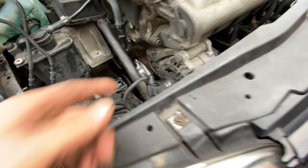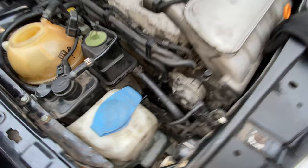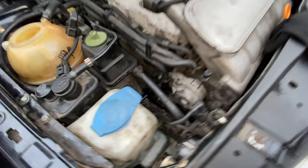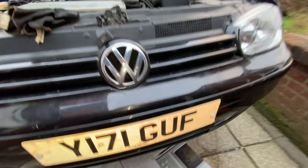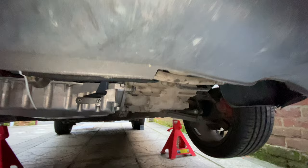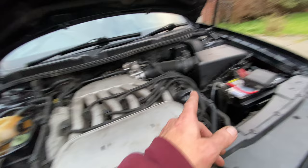There we go. I'm just going to get the bolts in quickly but loosely, and then we'll lower it all back down and put it all back together. I've got everything back in and tightened up. Before I lowered the engine completely — with about an inch gap — I was able to get the bolts lined up, start them off, and held everything in position as I slowly lowered the engine down. Then before it was completely touching, there was a bit of swing movement on the gearbox, so I had to swing it backwards and forwards to get the two pendulum mount bolts in. They're all tightened up now.